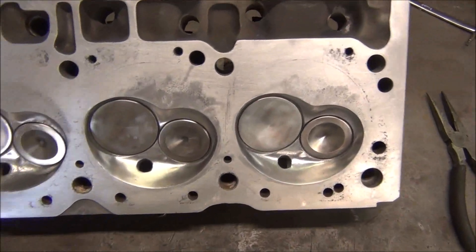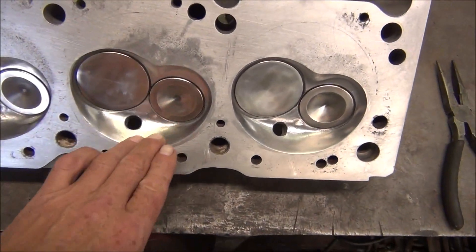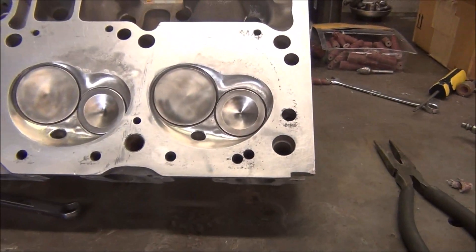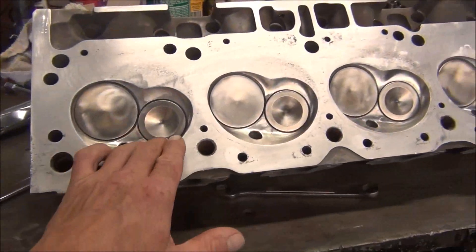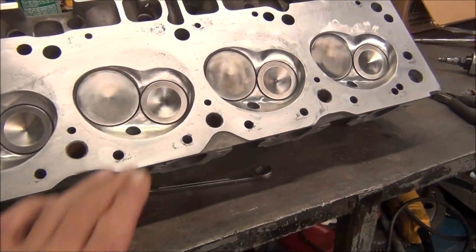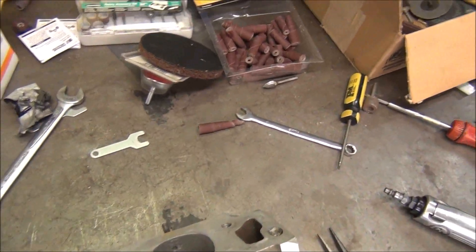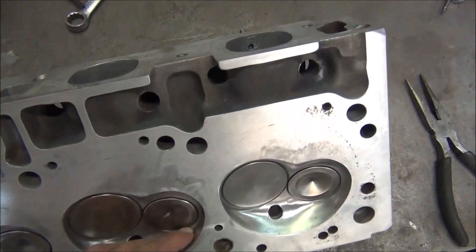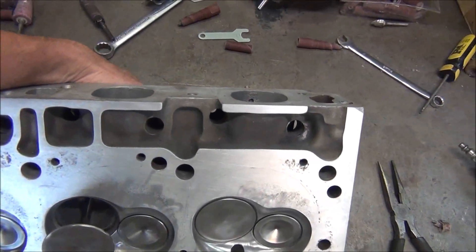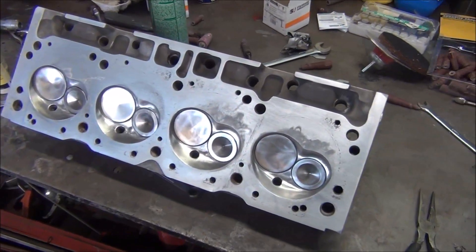It's not like we're paying to have this thing put on a flow bench trying to squeeze ridiculous amounts of ET out of it — we're just trying to make an improvement over what we had. I am a low budget racer, so if you criticize anything I do, remember that. I'm not one of those guys who spends thousands and thousands of dollars to go a half second quicker on ET. We're just looking to use what we got and make it a little better. Anyway, that's all this video was about — polishing combustion chambers. The next video we make will be lapping these valves. These are in pretty good shape already so it won't take long, and I'll show you what I do on that.